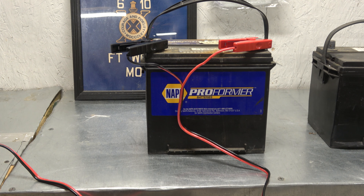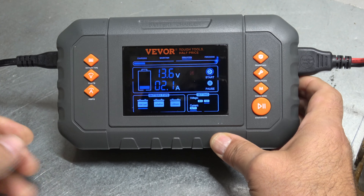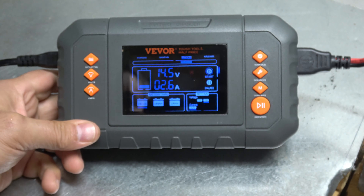Because we have some voltage this battery is just about dead at 12.1 volts — anything lower than that is about a 25% charge. We're going to go with desulfation to try to bring this battery back from the dead. We'll set the voltage to 12 volts, current to auto, and press play. There she goes — the amperage is starting to come up, the voltage is starting to come up. You can see our battery is at a very low state of charge.